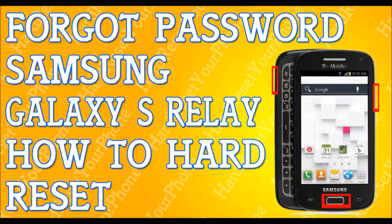When you see the Android system recovery screen come up, let go of all the buttons. Once you're in this menu, you're going to be using the volume down key to select wipe data factory reset. Select wipe data factory reset and confirm by pressing the power key.